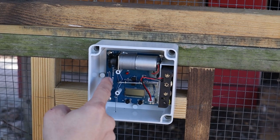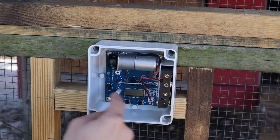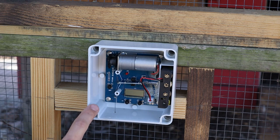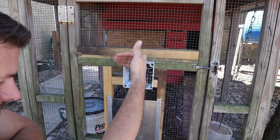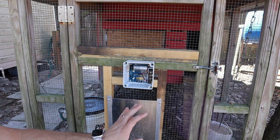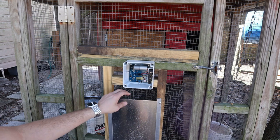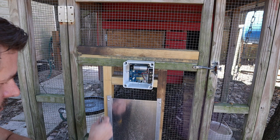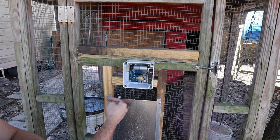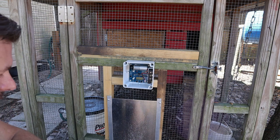The string has to go on the left side of these two white posts. There's a sensor that detects the tension. When you hit the reset button, it's going to pull the door up to a point where you let go, and that sets the height of where the door should be. When it lets the door down, it detects when there's no more tension on the string. He said if it doesn't drop, it means it's bound up somewhere. All I had to do was unscrew one of these screws and pull it out a little bit — that loosened it up enough and it literally just slides up and down no problem.